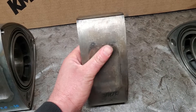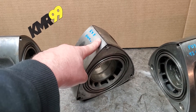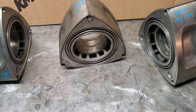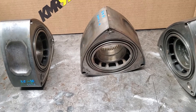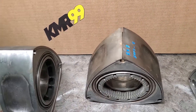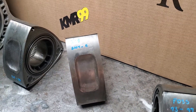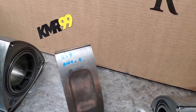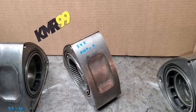That gives some specs: years 2004 to 2011, not the same apex seal groove depth as earlier rotors, but it is a two millimeter apex seal, different side seals, different corner seals, and your oil control rings are interchangeable. I hope everybody enjoys this rotor tech talk with KMR. If you have any questions, definitely feel free to ask or comment below. Make sure to check out the Kyle Mohan Racing website, say hi on social media, come to a Formula Drift event. We love talking rotaries, making fireballs. It's all about that brap. Follow Kyle Mohan Racing.